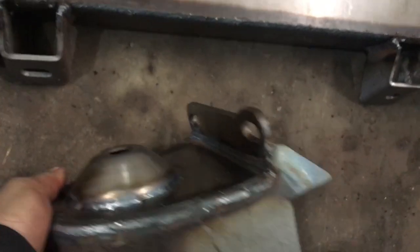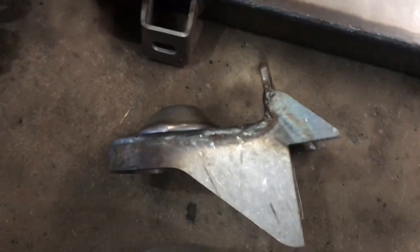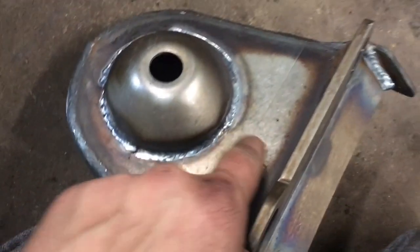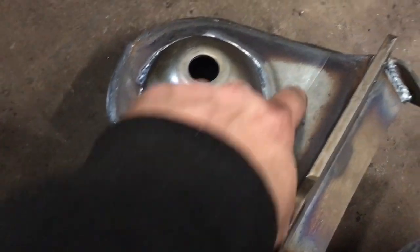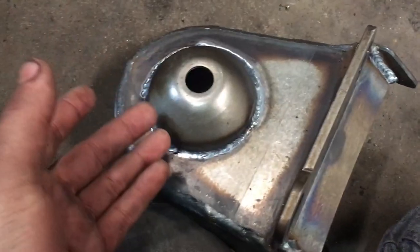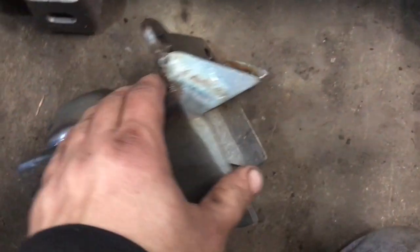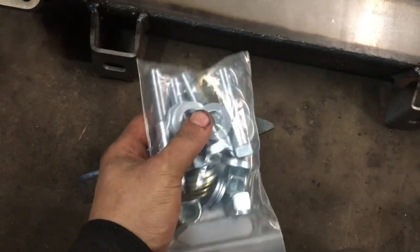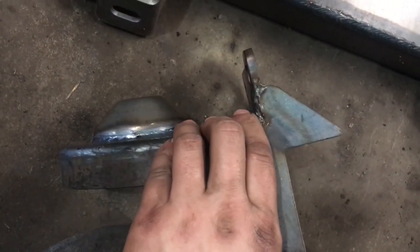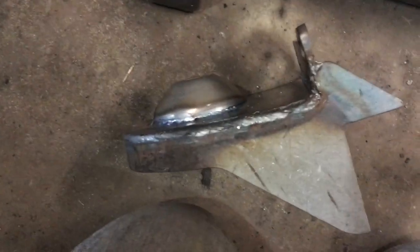Another cool thing — and a key reason I chose TCI — is that the upper control arms mount horizontally. That way if you hit a bump, it won't bend. Some competitors have slotted mounts where the upper control arms bolt into slots, and what happens is you hit a bump and that can actually move, throwing your car out of alignment with camber all out of whack. With this kit, they come with washers that act like shims so you can set your camber correctly. The instructions cover camber, toe-in, and toe-out adjustments. This is a very well thought out kit.